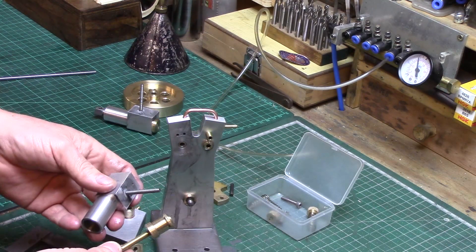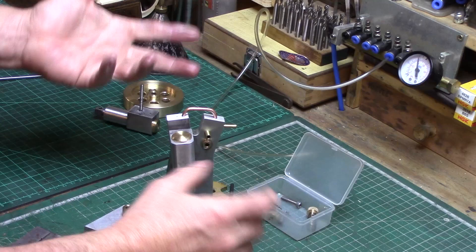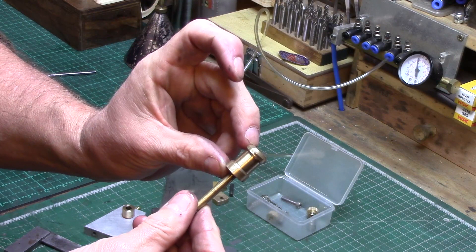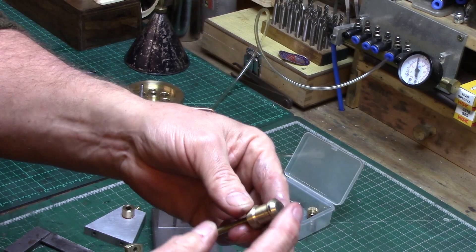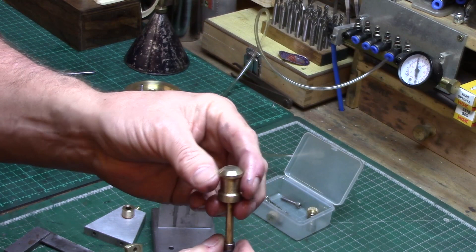I also suddenly realised maybe the portholes aren't aligning properly, because that was another one of the issues I thought it was. Anyway, finally I've sort of sorted it - well, I haven't sorted it yet. What I've actually had to do is reduce the length of the piston by three millimeters. I've taken about two millimeters off the top crown, and then I've just put a 45-degree chamfer on there to be able to bring it down a bit more as well. So hopefully when I put it back together now, it should run a bit smoother.